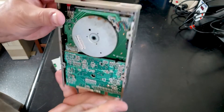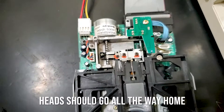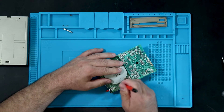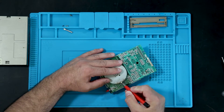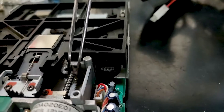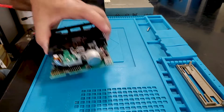The Chinon 354 is really crusty with all kinds of corrosion, but let's see what we can get out of it. Pre-testing showed the heads are not moving — probably just needs lubrication. I pulled it apart and stripped it down, starting by cleaning up the crusties on the motor. I didn't want to repaint the flywheel and risk throwing it out of balance. Inside, the floppy is full of dust in all the mechanism, and there's even a wad of dust in the home position sensor, which can certainly cause issues. I start by blowing out as much junk as I can.